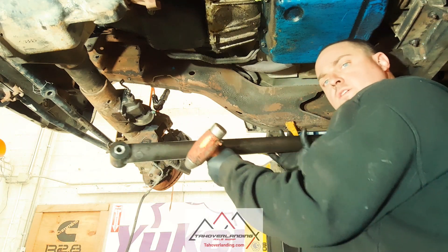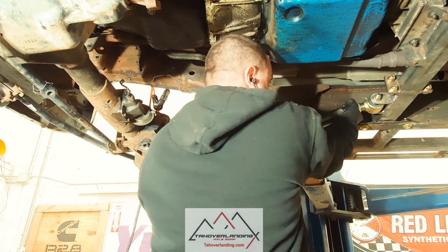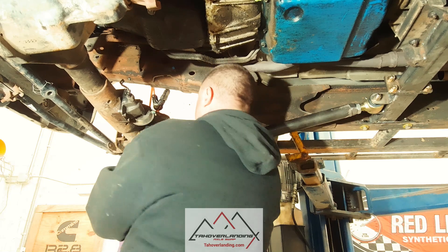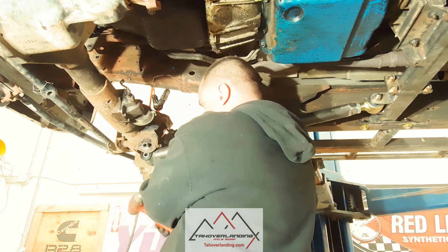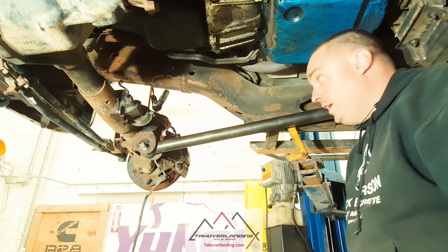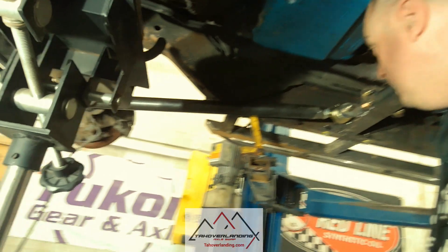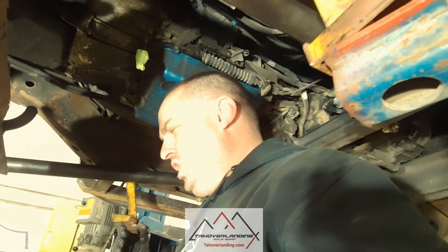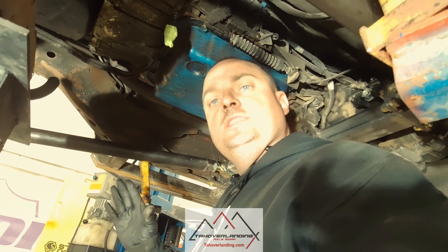Take the radius arm, slip it onto the joint at the frame end, then get it stuck up in the axle — sometimes you've got to wiggle a little. Now we can start figuring out where things need to go. I can get the axle set front to back — I'm going to measure from the body mount right to the edge of the axle and get it perfectly set before I tack weld to make sure it's in the exact spot I want it.